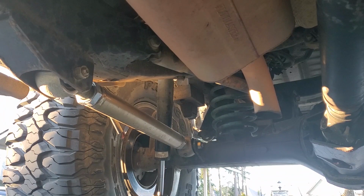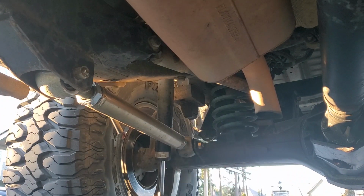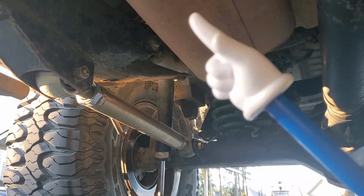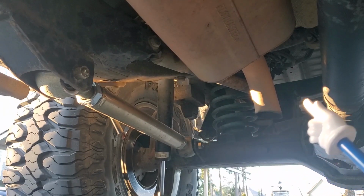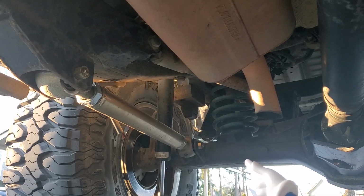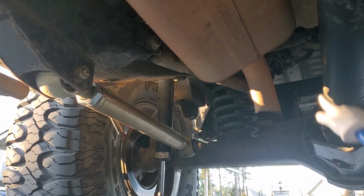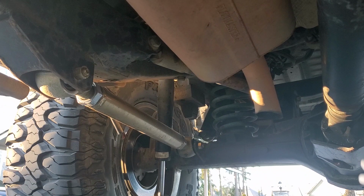So my rear end's going to be different than most of the people watching this, because I'm 3-linked. So I have my 3rd link up here, goes to back there, so I check that bolt, check that bolt, check the 2 lower link bolts on both sides, check the other side, lower link, and then check all of the diff bolts as well, the 3rd member bolts. You can also check driveline bolts while you're down here if you want to. I just put this driveline in like a trip ago and I already beat it up, so that's great.